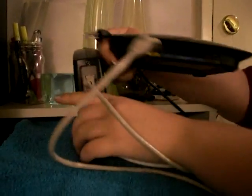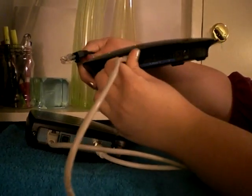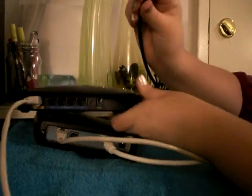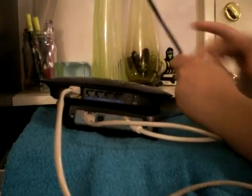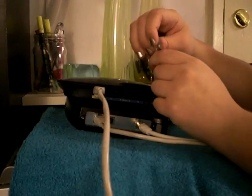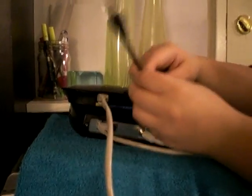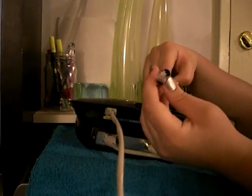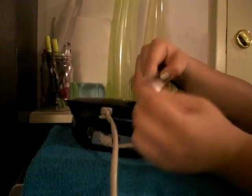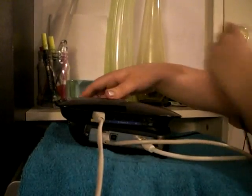So now we have these two hooked up. The next part is how to hook up your desktop computer whilst having your wireless router hooked up. In this case, we hook up another ethernet cable to the back of your desktop computer into the ethernet port. One side is already put into my computer. Are there several holes in the back of your computer for ethernet ports? In the back of your computer there will be several ports — they will look confusing. But again, the ethernet cable is different from a telephone cable in that it's fatter, it's wider, and you cannot fit it into a normal telephone cable hole. So put it in the special ethernet port.